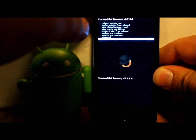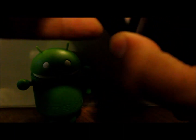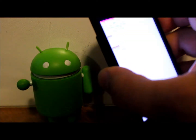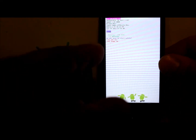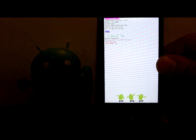We're going to power off — you have to push the power button down. Then pull the battery out, put it back in, hold volume down and power to get back into HBoot. This time when it scans and finds that file, we're going to say yes — press volume up to go ahead and install it.